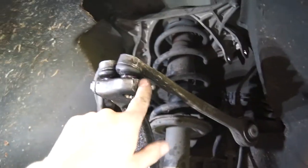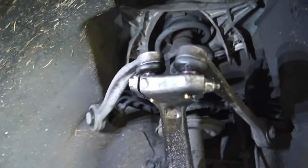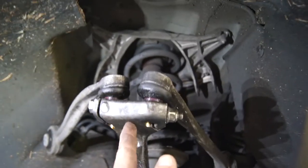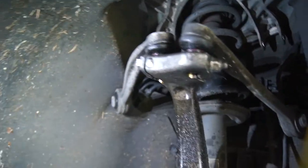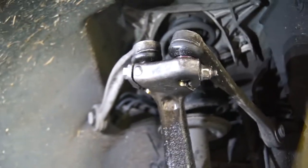I came close to snapping this bolt. It is in there. I let it soak for a couple hours. I hit it with heat underneath, heated it up pretty good, tried running it back and tapping it out, coming from this side and pulling it out, and I just couldn't get it out. I was scared I was going to break it or twist it off.